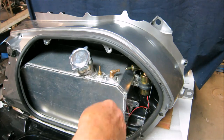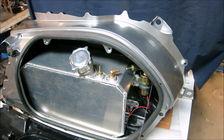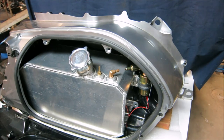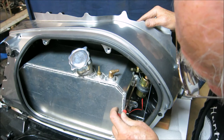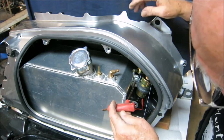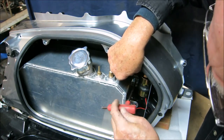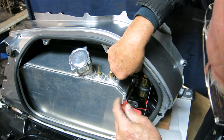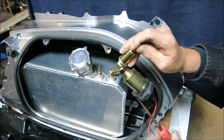We'll start by showing how to get it out and how to get it back in. The fuel pump will need to be removed for removal, and of course we'll take out that bolt at the bottom. The hard part of removing the fuel pump will be getting the hose off of it, but there's a mount that is threaded and tapped so you don't have to mess with a bolt on the backside once the fuel pump is removed.